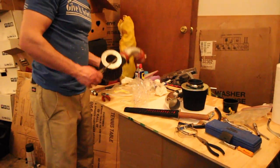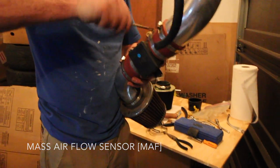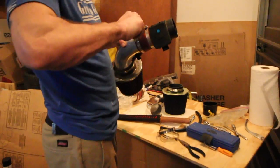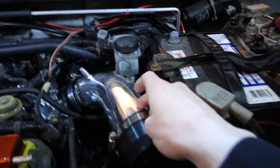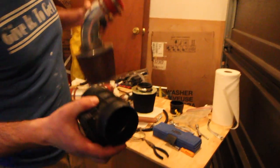Now I actually need to take the old one apart and get my mass air flow sensor off. That makes sense now — I was wondering why it was funneling down. It's got the three inch here, and then it's going to like a two and a half. Because it has to go with the stock mass air flow sensor, so that makes sense that that would be the two and a half.